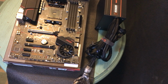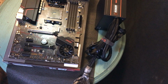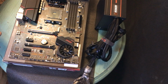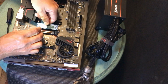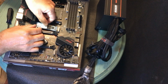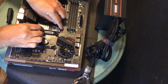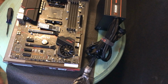Yeah, it came. I looked at the chip. I flipped it over. It has pins in it. I tried to seat the CPU into the motherboard. It wasn't quite going. Of course, you never force those damn things because that's an expensive mistake if you break it. So there was one bent pin on the inside. I went, what? How did that happen? It wasn't me. I swear to God. I don't know. I was very gentle with that thing when I took it out of the box. So who knows? I went and got a pocket knife, and I was able to get the one pin and just give it a little push and straighten it out. And it'll eventually go into the slots here.